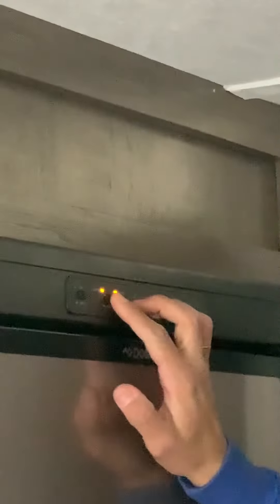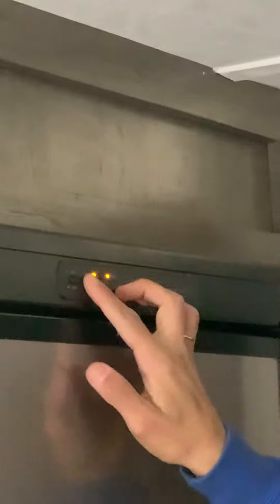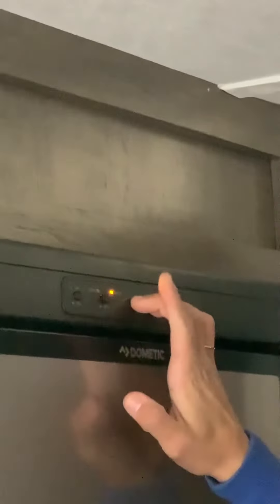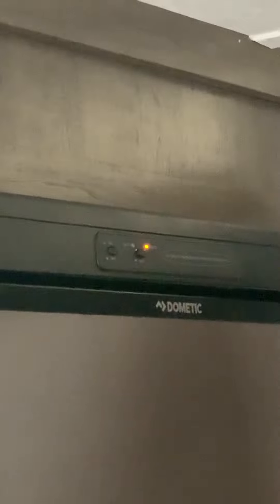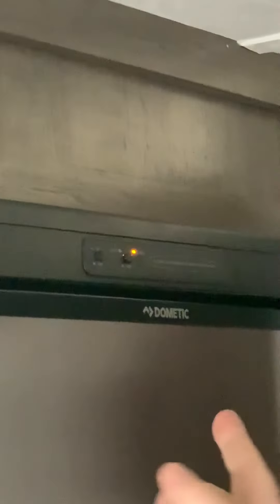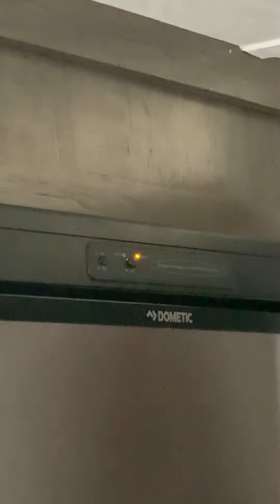It's trying to pull off battery power, which isn't enough. So if I have electricity hooked up, I want to use that; if not, I can use the propane. If I'm in the middle of nowhere without electricity, I'd open the propane tanks — then the check light would go away. The check light really just means something's wrong: whatever power source you've chosen isn't working.